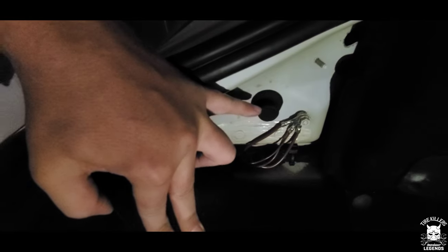This guy right there is a hole, and behind the hole is a screw port, which is literally through this other hole that's in the back. So what I have to do is put that tool in there all the way down to the back until it matches up with the little screw port that loosens and unloosens the safety mechanism to keep the headlight in place. So it hooks it in, unhooks it, you pull it out. So that's what we're gonna do right now.